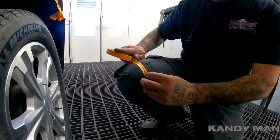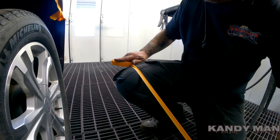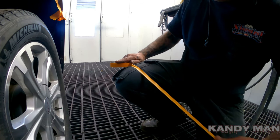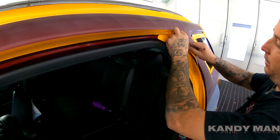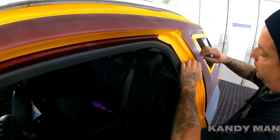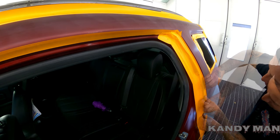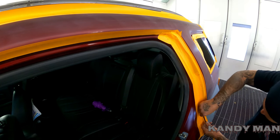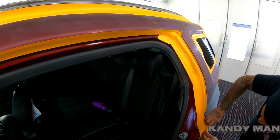I pull the tape and put it against my knee — you can see where it's folded over. When it's folded, you just pull it and that'll give you a perfect nice fold tape. Now when you put this on, since you got that edge coming off of it, it fits perfectly in. Don't pull it tight — just lay it in nice and easy and it'll contour to the car without pulling back on it later. If you have a bend, just cut it and start it back over — it works better than trying to bend it.